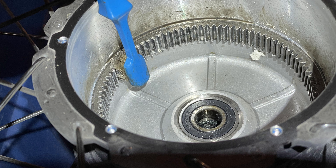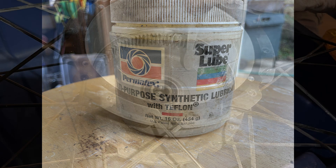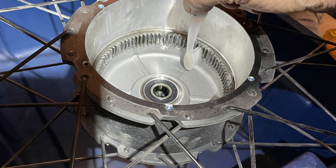There was only a thin layer of grease on the gears and it felt a bit dry. I used a toothbrush dipped in a little WD-40 to clean the old grease out of the metal gears and replaced it with Super Lube Multi-Purpose Synthetic Lubricant, which has been a popular choice for hub gears. It is a reliable lubricant and there doesn't seem to be a definitive product to use for this. I dabbed it around on the metal gears with a finger and then worked it in with a toothbrush to try to coat all of the gear surfaces beforehand rather than rely on the planetary gears to spread it around.